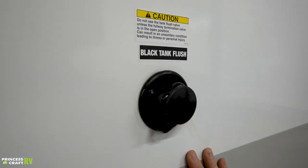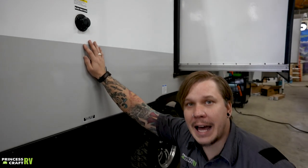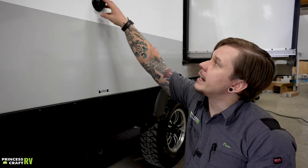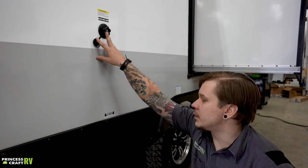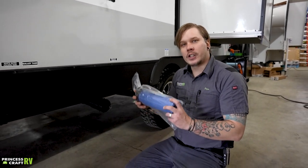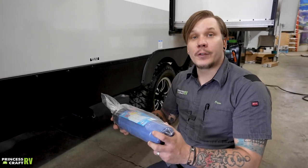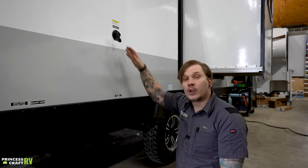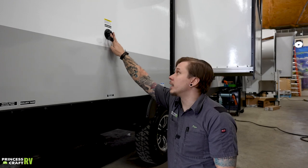Another cool feature on the Ibex is the black tank flush, which corresponds with a jet inside the black water tank specifically designed to blast off compacted waste and keep sensors as clean as possible. After dumping both systems, open the black water valve, hook any old garden hose to this fitting, and pressurize the system to let those jets clean the tank. Very important: only do that with the black water valve in the open position so you don't overflow the tank. The sewage hose included in your starter kit is meant to get you started but won't last forever. When upgrading, I recommend one with a clear elbow — that way you can watch until the water runs clear to know you've sufficiently rinsed the tank.